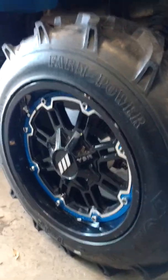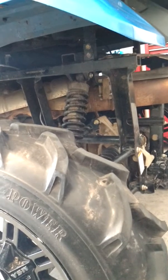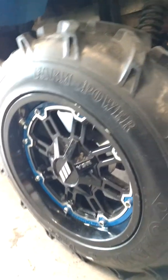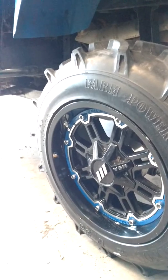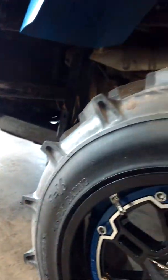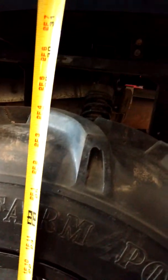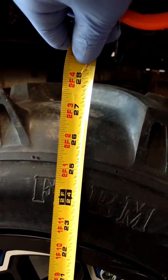Put them on here, done some measurements. I do have this 1-inch eBay spacer lift — in reality it's only given me about half an inch, but keep that in mind. Front and rear I have right at 13 inches, coming from the floor to the bottom of the frame. That's 13 inches versus 9 to 9.5 when we had our stock 24-inch tires. So using the old tape measure, measuring at 5 PSI with the full weight of the machine — I've driven around a little bit so the springs have settled — it's realistically maybe a 28-inch tire.